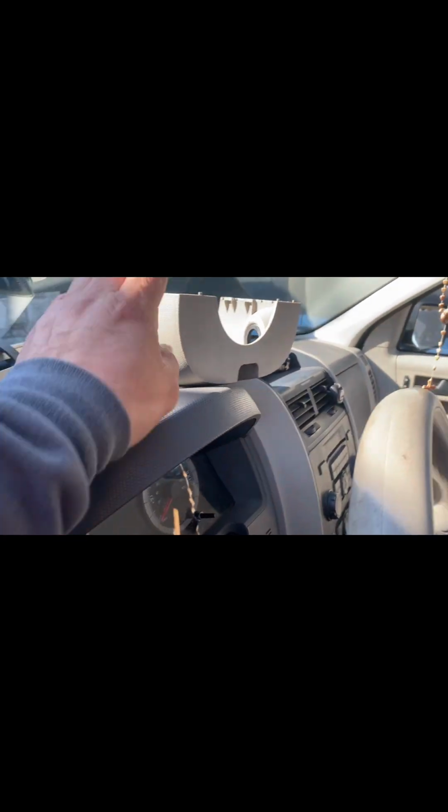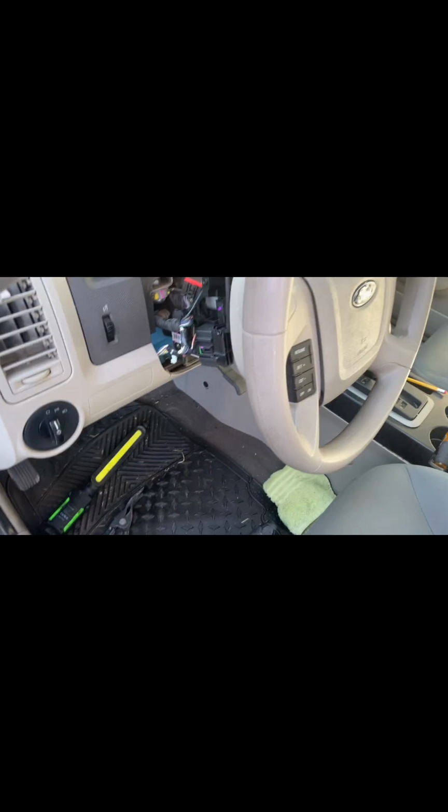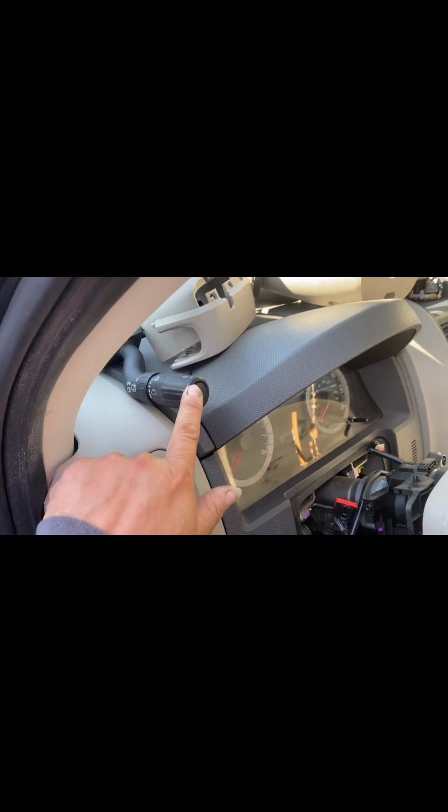Now this is just how to install it, how to take it off. You got to get rid of the plastics. Easy. You have 3 on the bottom. That's 1 cover, that's the bottom one, and then of course you got 2 covers here on top. I took off this right here. This is for something else. Simple. You need a 5.5 socket, this small, to take off these 3 screws that go on here on the bottom.